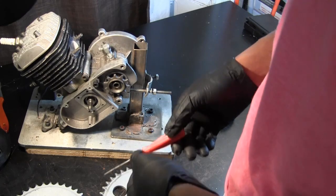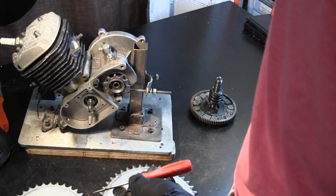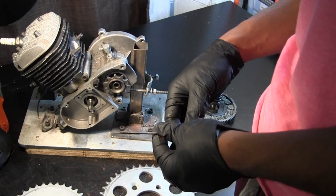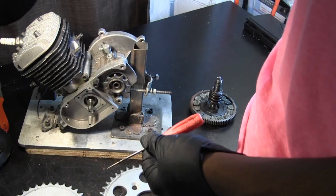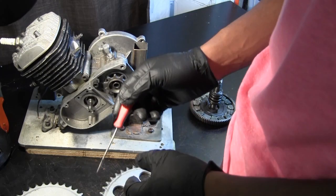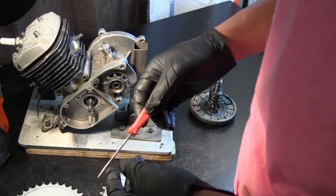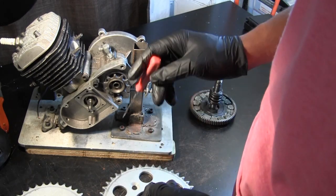Anywhere between 38 and 41-tooth works well for urban riding. If you do performance modifications to your engine — like increasing the compression ratio — you can make up for the torque loss of a 36-tooth and achieve higher top speeds. Another benefit of the 36-tooth is that at similar speeds you'll be cruising at much lower RPMs than with a 44-tooth, putting less wear on your engine. You want to stay under about 6,000 RPMs unless you've done balancing modifications — go above that and you'll start feeling serious vibrations.